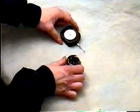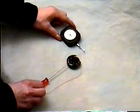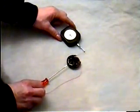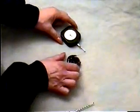However, if the screw has been adjusted, reset the gram pull to 11 to 14 grams and carefully lock the adjusting screw with Loctite or fingernail polish. Then recheck with the tension gauge.